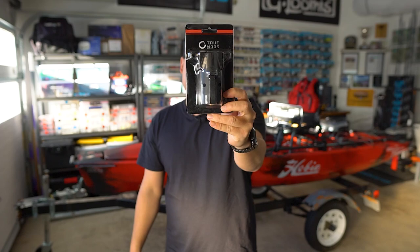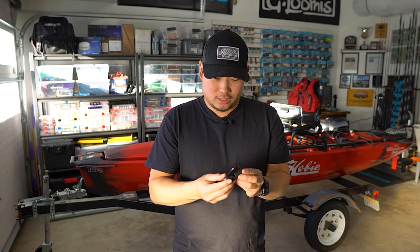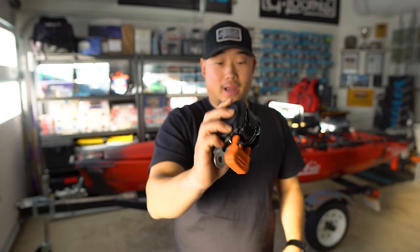I also had to purchase an adapter — a seven-way to five-way adapter for my truck, since they don't naturally come with five-way plugs. The nice thing about redoing all the wiring is that I can add extra lighting. I've got these rock lights from Amazon — reviews seem good — and these are going to be additional backup lights for the kayak. We back down these trailers to some pretty dark and narrow launch spots, so having lighting behind me so I don't back the kayak into a rock or a tree is going to be great. I also have two extra lights I might put underneath for rigging. The trailer also didn't come with side marker lights, so I got those on the way — LED of course — both for safety and to be legal.